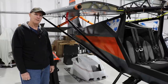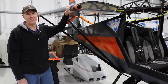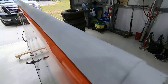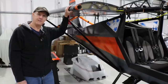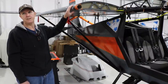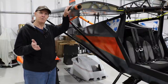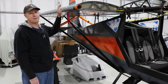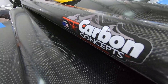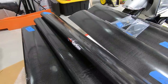Talk to me about what you've done to the wings. These wings are already covered, which was a problem. Steve Henry makes these leading edge cuffs, and I went ahead and installed them with 3M 5200 permanent bonding solution and blended them in. Because the wing was already covered it was a pretty difficult installation getting it as smooth as possible. This is also getting carbon concept slats using Steve Henry's brackets, which are all mounted out — I'm just waiting to reinstall after I do the wrap on the plane.